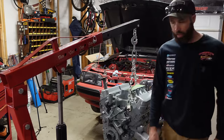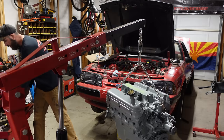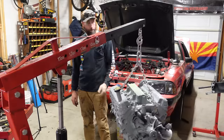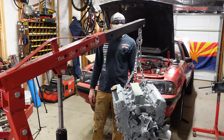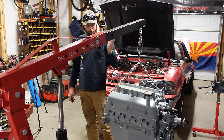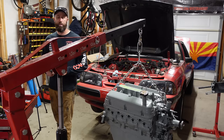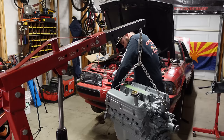It's in the air. It's kind of surreal. Just a swinging. Now there's a cover on the back of the cam. If you change out the cam, don't forget to slap that bad boy back on before you put the shim or dust plate in. You're gonna find yourself with one hell of an oil leak and a walking camshaft. It won't walk too far, but still bad, real bad, not good. Also doesn't hurt to sling a little RTV in there just because it's in a very hard place to easily fix if it starts leaking. Boops right in.